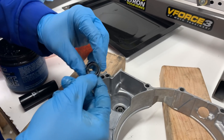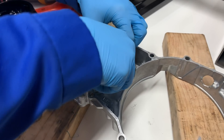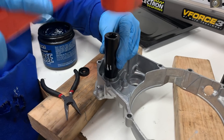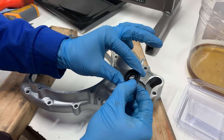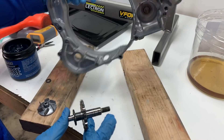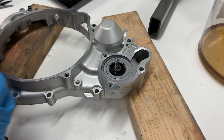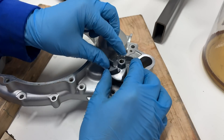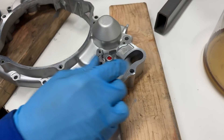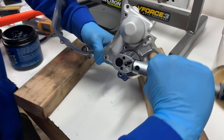I'm just going to put in our seals for the water pump. It's important to make sure the open end of the seal is facing towards the engine on the first seal. And then for the water pump seal on the other side, the open end is going to be facing towards the water so it keeps the water out of the engine oil. Don't forget to put our washer here, and then we'll go ahead and put our impeller on, using some thread locker on the impeller. Now we're going to torque down the water pump to 10 foot-pounds — just hold it with a wrench on one side and grab it with the torque wrench on the other.